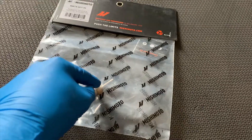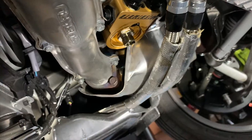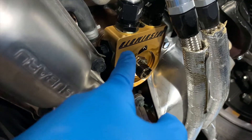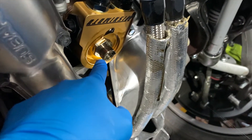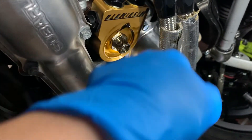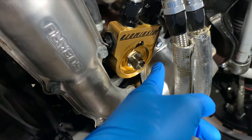I'm going to check out the oil sandwich plate because that's where the thermostat is housed. Here's the Mishimoto oil sandwich plate — I believe right here is where I need to take out this set screw. I want to look at Mishimoto's diagram. I already took out the oil filter and drained the oil, so I'll let this drip a little, clean it off, and see if I can get this off. If not, I'll have to take out the AN lines.